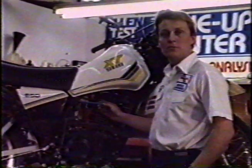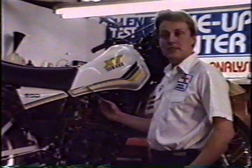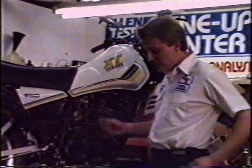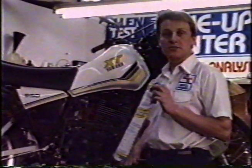Normally the carburetors on my XT550 would sit level. To eliminate the problems of fuel overflow and improper jetting while wheeling, I flip my stock intake manifolds over, angling the carburetors up. This created an airbox routing problem, which I solved with some emissions control duct hose that I got at my local automotive store in a package like this for about $2.